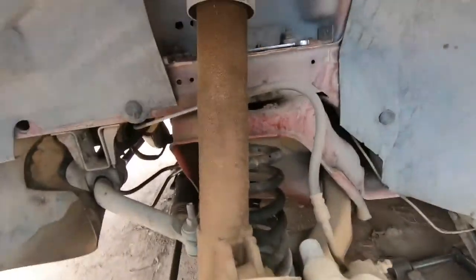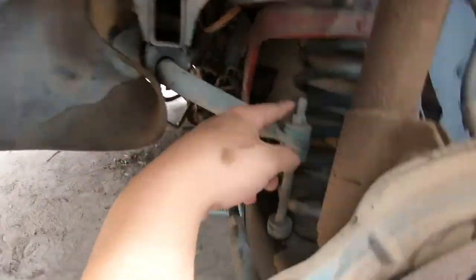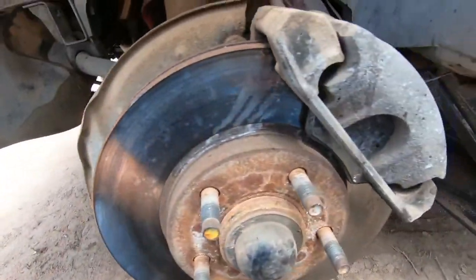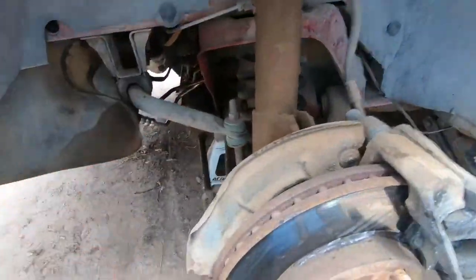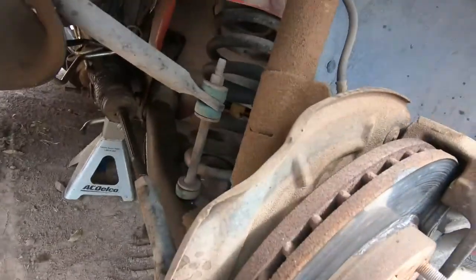Right now I did take off — well, I didn't take off the brake line but just loosened it from over here so you can have some slack when it drops. I'm going to have to take these two bolts right here, and probably this too, so it'll drop. Of course you want to put your jack under there because that spring is loaded — it has a bunch of tension, so you don't want it to just drop out and hit you. Do it nice and carefully.